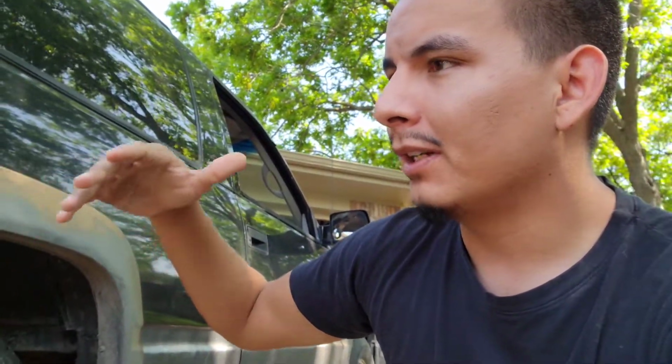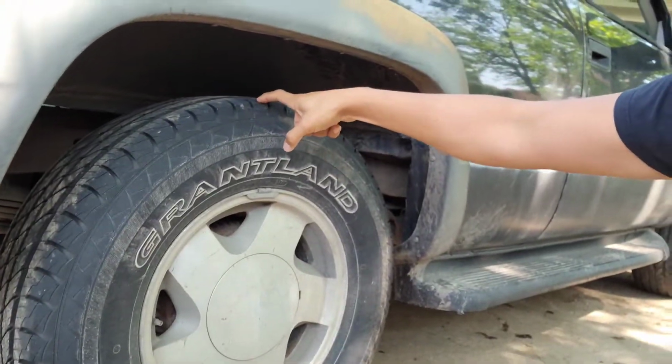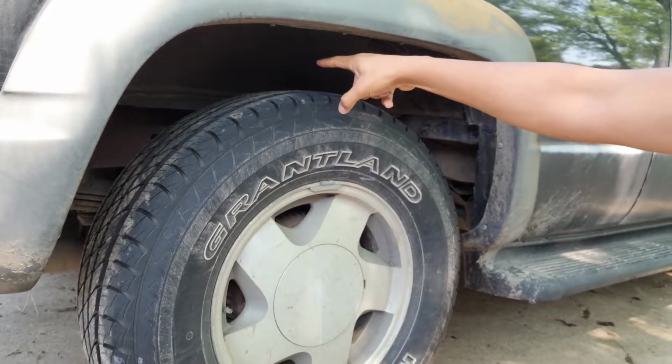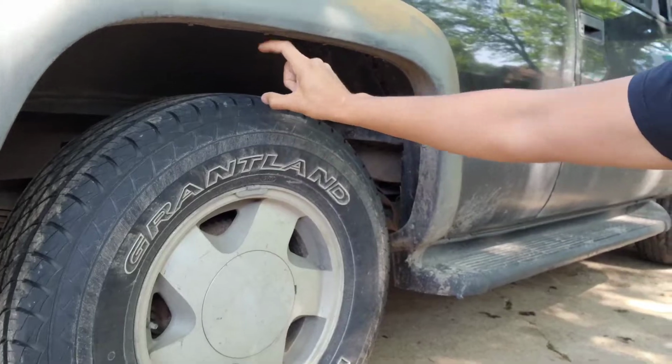So with me going to the 22s, that would be a 285/45/22, I'll be at the same mark where I'm supposed to be. It's going to be about an inch and a half taller up here, and obviously instead of a 16 it's going to be a 22, and still a good amount of meat. I was going to go to a Milestar, like the Patagonia MT, I think it was, a hybrid tire.